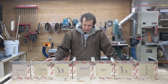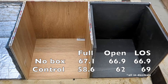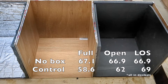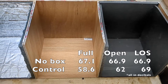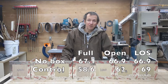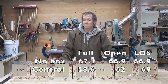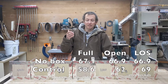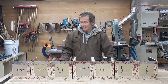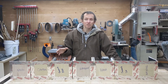After that we've got just bare plywood, which shows that in the full box enclosure, even thin less-than-eighth-inch plywood reduced the decibel reading by eight decibels — a pretty substantial difference. It shows that just having any kind of cabinet around your fridge can help. That said, when we look at reflected sound, if you've got line of sight to the fan the cabinet will just reflect noise back at you, but it's a good baseline for what a plain plywood structure does.